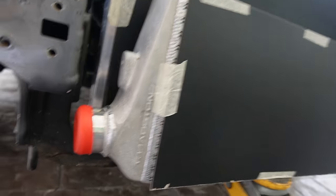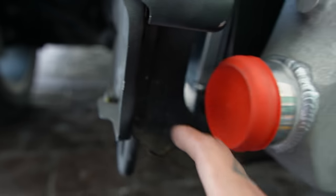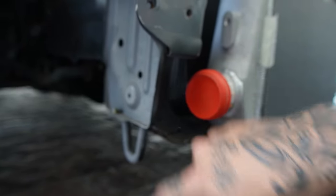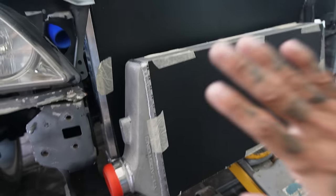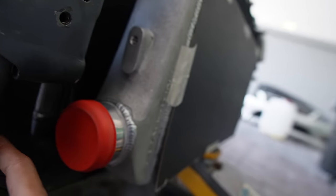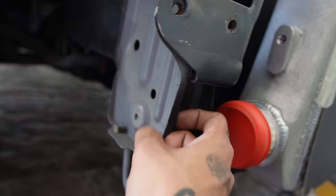After that's all done I guess it's time to move on to the intercooler mount. I think this is not going to let my pipe clear so I need to probably shave some of this chassis part off. I don't want the intercooler to be too far out because I don't want to cut much of the bumper. I'd rather cut the chassis than the bumper, but I want it to sit just nice inside. The best would be to get it behind this bar but it's kind of impossible because I'd end up cutting the main area. So just a bit — it's not gonna do any harm. I was having second thoughts but I was going to go with it.